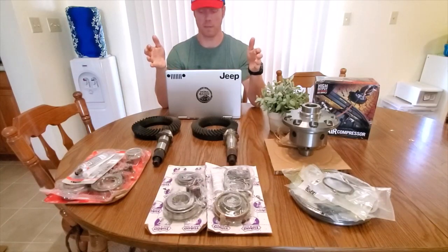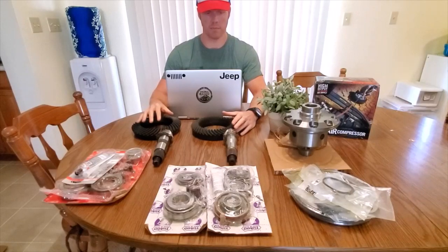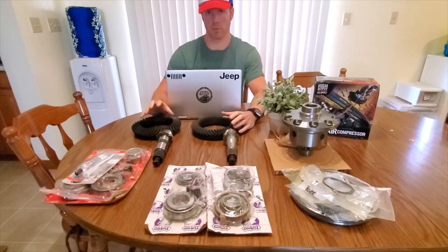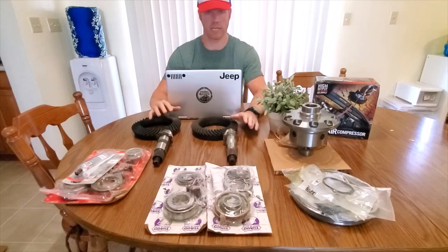What I have on this episode is the front and rear ring gear. I wanted to show and break down a little more detail because when I first got away from my TJ or my JK, the third generation of Dana 44s made by the Dana Corp, Spicer Corp axles are very unique in the sense that they redesigned some things. I wanted to cover those differences and why these gears will not transfer in and out of JK axles or previous TJ Dana 44s.